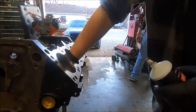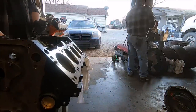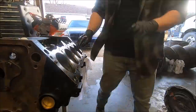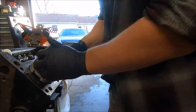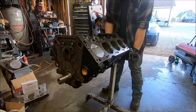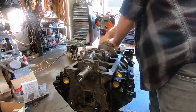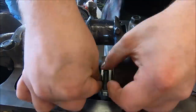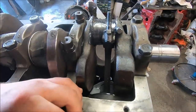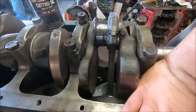You're going to see a lot of speed footage, so you've been warned. Now we're just getting everything lubed up - all the cylinders get a light coating of lube. You don't want metal-on-metal contact, especially on that first start. While I'm doing that, Dad's getting all the piston ring grooves cleaned out so we can get all the rings installed. Number one piston is already in. We're going to get it flipped around and get the first rod cap on. All the rod journals get lubed up again - no metal on metal, no dry anything. Better to have the bearings installed when you're putting the rod through rather than dropping one in - words of experience.